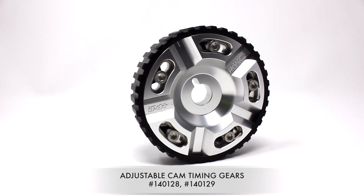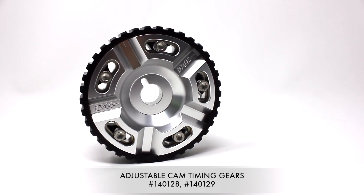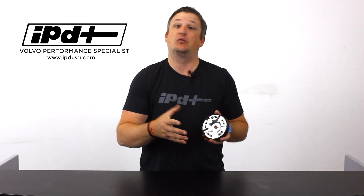What's really cool is that this is 6061 billet aluminum, hard anodized on the outside. We carry these for square tooth and round tooth for the later model RedBlock cars. The hard anodizing helps with belt wear on the outside. Everybody loves billet — they like 6061 machined parts. This is a really trick part to put on the front of your car. We're glad we brought back this variation where you can actually install it with the timing belt in place, manipulate it by just loosening up these bolts, and get the right timing marks you want without having to remove the whole assembly.